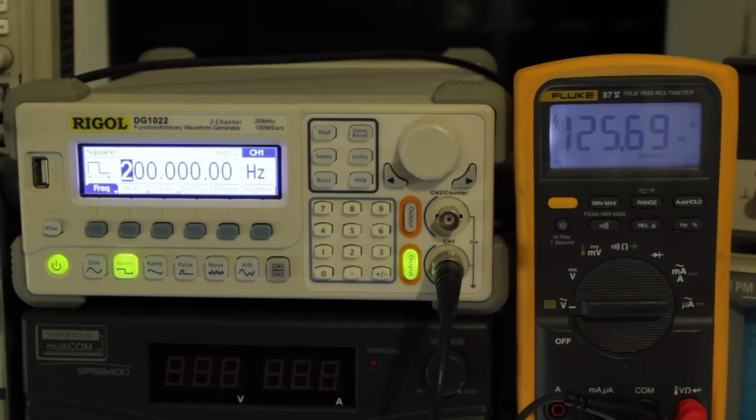I was honestly expecting the UK Speedo to do the same thing, but it would appear that it's an ECU difference between the UK and the JDM ECUs, in the sense that the UK ECU does not have a speed limiter within it. Again, there is a difference between the UK and the JDM ECUs based on the fact they have a different fuel map, so I wouldn't at all be surprised if they've actually got other differences as well, such as the difference between the speed limiters.